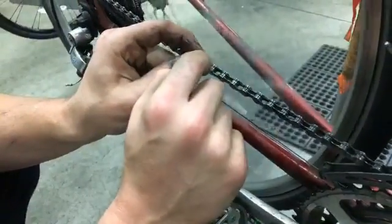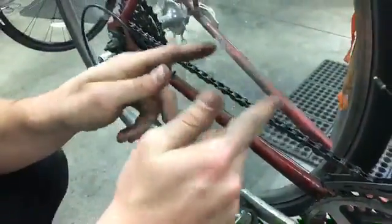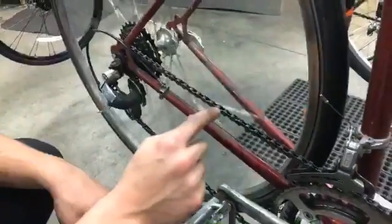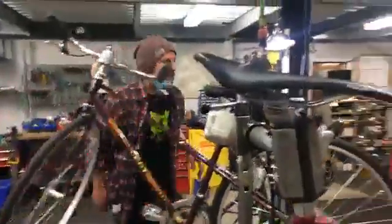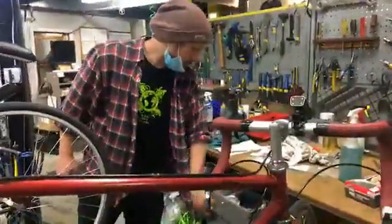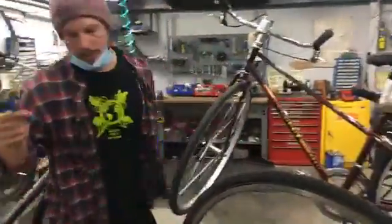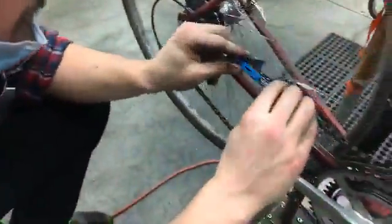I don't think it's the actual metal face plates, but nevertheless, the chain will stretch out, so its length will stretch out over time, and the distance between the rollers will increase. And you can measure that pretty precisely with a chain checking tool, or you bring it to Bikes Not Bombs. To Tool Time, if you don't have one of these, or you just bring it here and we check it for you. We do free estimates, so happy to do that.